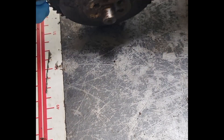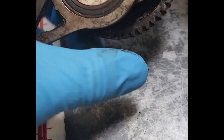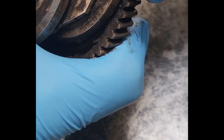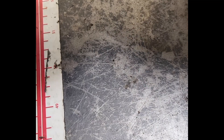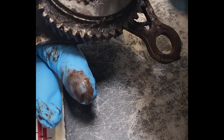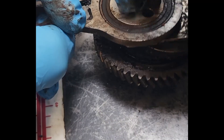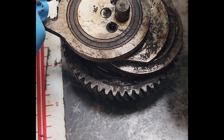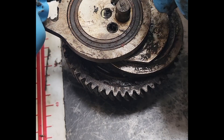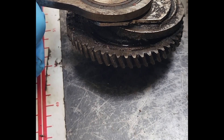Let's take a look at the gear housing — I can't even move this stuff, it's solid, it's cooked on the bottom and the top. You can see the rust on the connecting rods, so this is never going to run again. It's not fixable in its current form. The way they've designed it uses a teacup washer, you need a special press to pop it off, and there are pins that have to come off too — very labor intensive to rebuild.